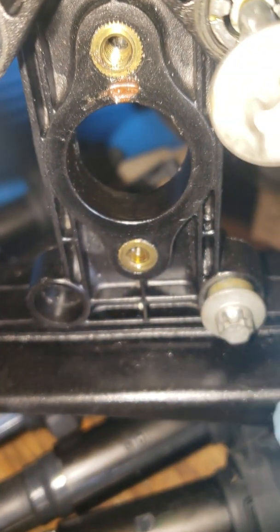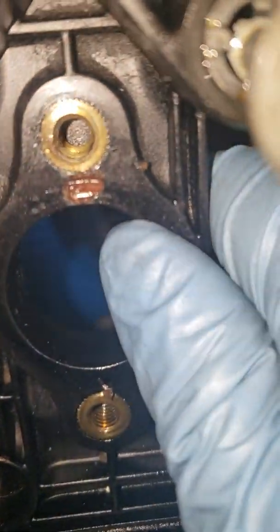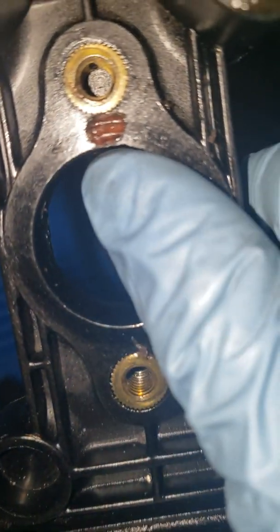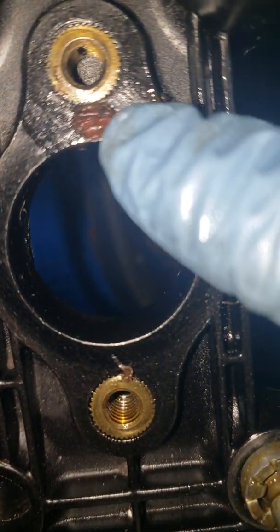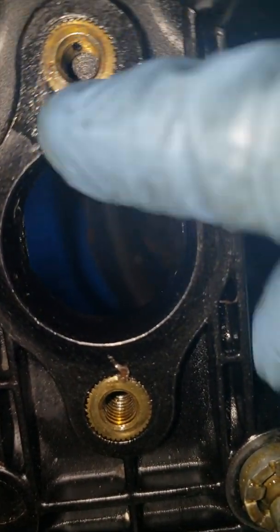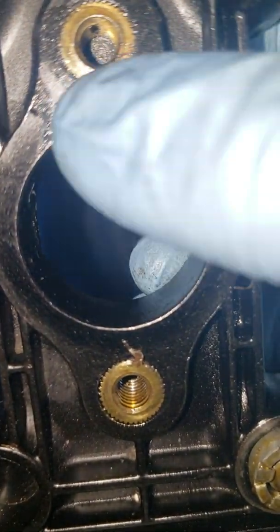Here's a tip for how you can set that eccentric shaft — which preloads the springs and gives you more lift — to max lift manually. What I did was drill a little hole through the valve cover, right in between this screw and the gasket seat. That allowed me to drop an allen key down through this hole. You can see the gasket maker I put over the hole, because you don't want any vacuum leaks, so I plugged that hole after the fact with some gasket maker.